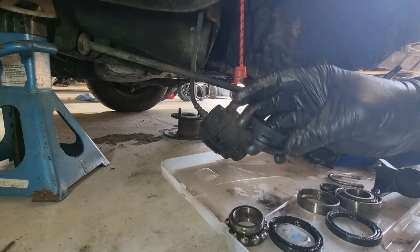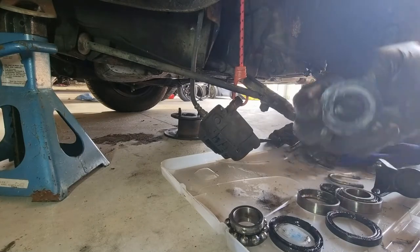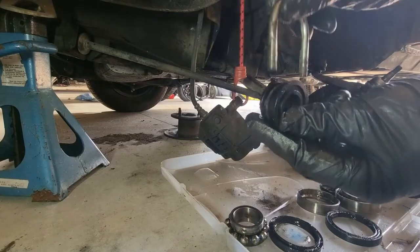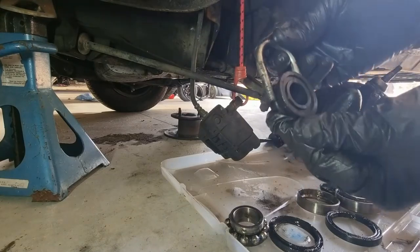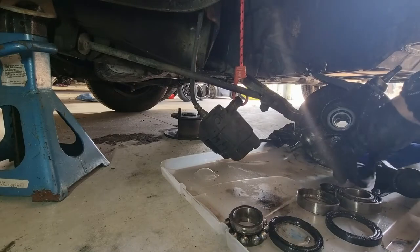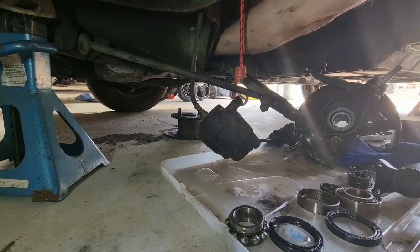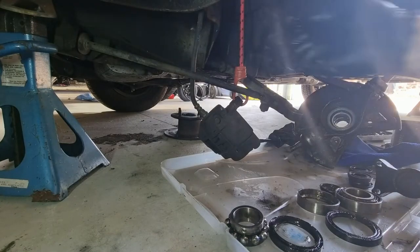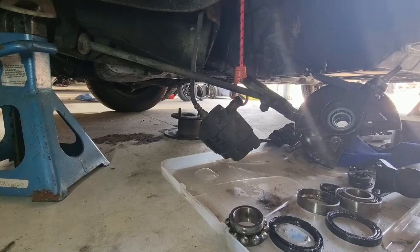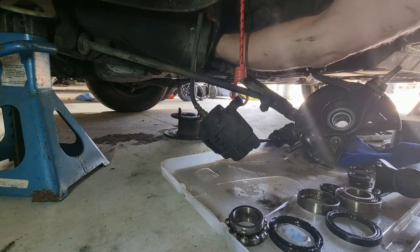These plastic bits slip over the end of the uni cups, and then the u-bolts drop in and go through like that. While I'm in here I might just give these uni joint cups a little dab of grease — just to say that I've been in there. May as well, while you're in there.